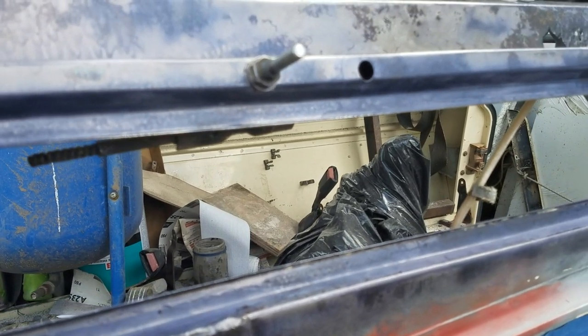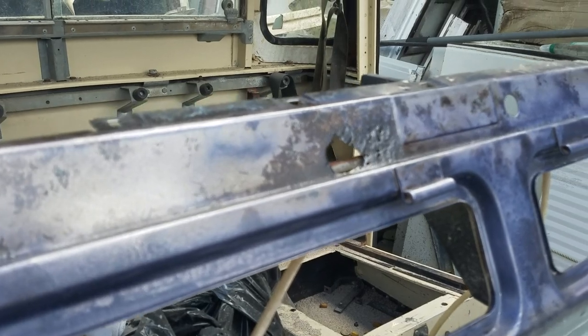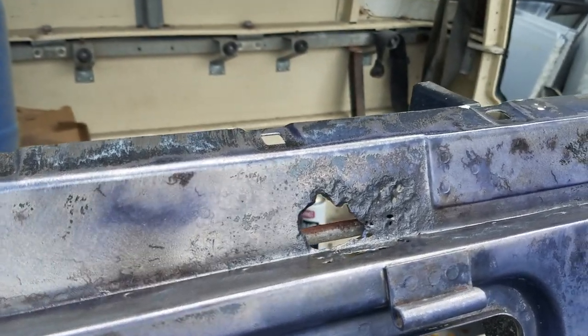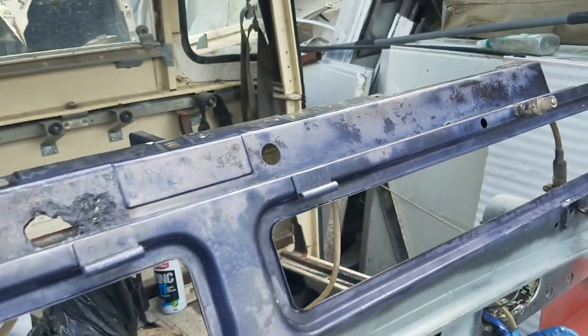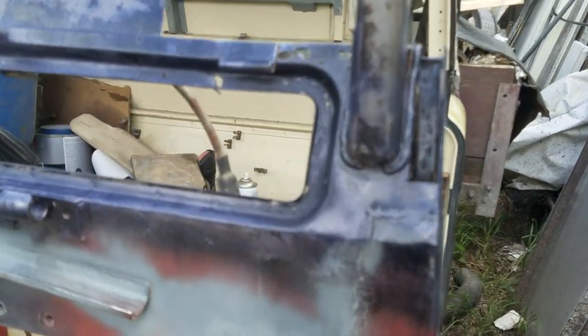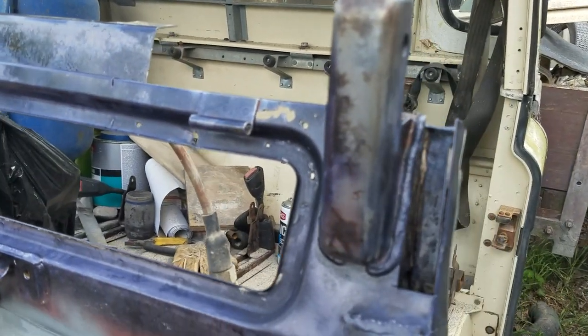The top left-hand corner, the passenger side of the firewall, was the worst part on the vehicle so far. I've done a lot of work here on the outside, but I've completely cut away the inside piece and taken it inside to work on the bench because it's in such a state. Now that I have most of the firewall primed, I can seam seal. You can see the big open gap, and also here — open gaps, so easy for water to get in. All the way up here, water can just pour into these gaps, sit there, and cause the dreaded rust.